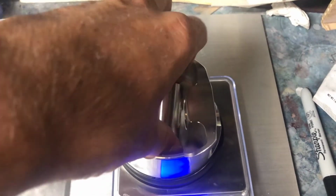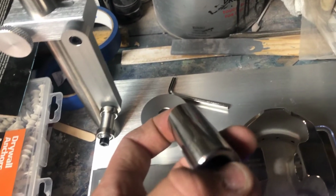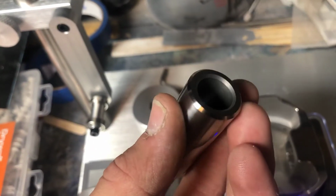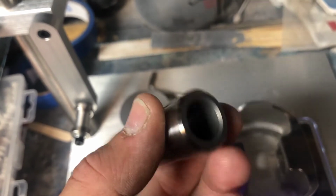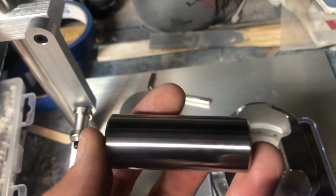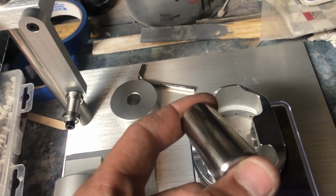Your wrist pin, with a Dremel tool and a die grinder, you want to take from the inside, which I haven't heard anyone say about the outside, so that's a good thing. But yeah, you just want to Dremel the inside, and how many circles you do on that side, you want to do the same on the other side. That way, it's still a balancing act. Remember that. Keep that in mind. Everything's got to be perfectly balanced.